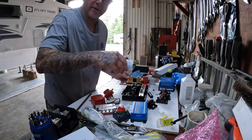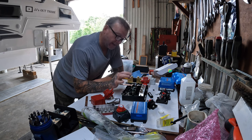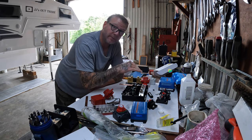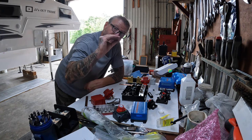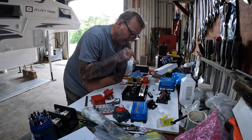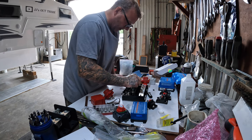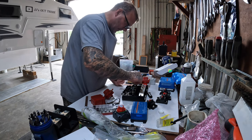Whether you're using a lug or a bus bar like I am, do not put anything between the bus bar or your lug and the fuse. Don't put a washer in between the two of them. You want those two surfaces to be clean and those two contacts made — that's where your current is going to go through. Make sure you do not put anything between them. Flat washer on top of the fuse, lock washer, then the nut.